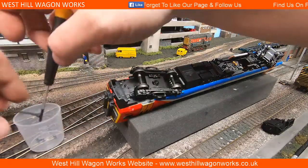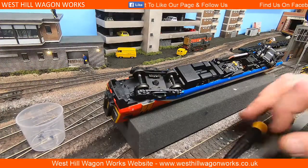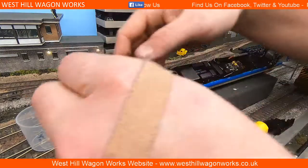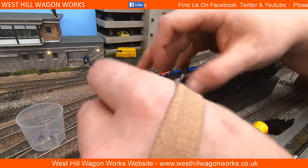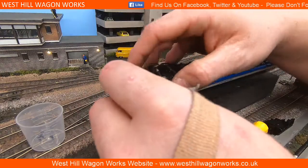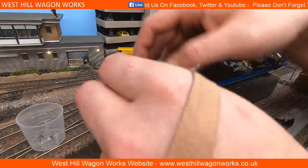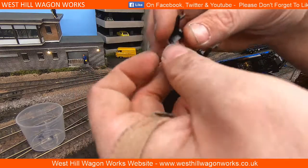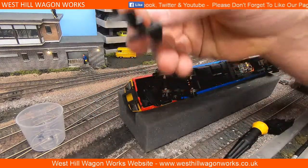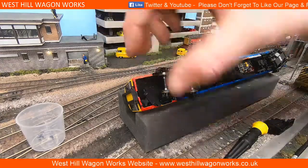There we go. There's all the screws out there. Cover my eyes or something. That's alright. So, nice tip. Right, okay. Just under the front here, if you pull the body sides very slightly apart, you'll feel it come loose, and as you see, the front valance comes off, and there are these clips. We don't want to break those, so we'll put that up the top here.